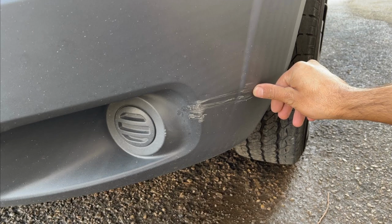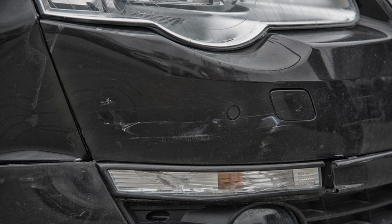11. Remove any visible tape from the front panel. Sand the area with 80 grit sandpaper to remove any protrusions. Fill in any visible damage in front of the car bumper with materials from the repair kit. Squeegee everything into place. 12. Coat and sand. Finish by coating the surface of the affected area with the coating included in the repair kit. Leave to dry and apply another coat. Smooth the surface with wet 400 grit sandpaper to bring everything together.